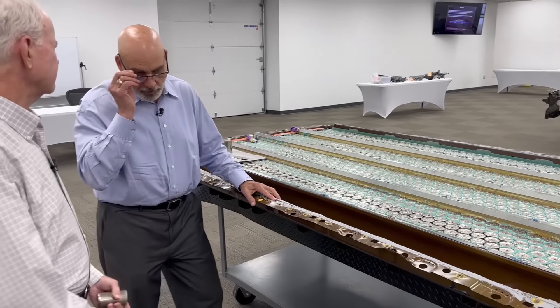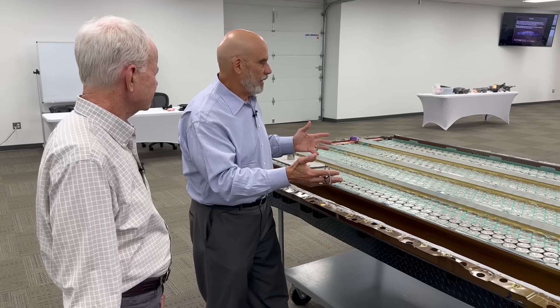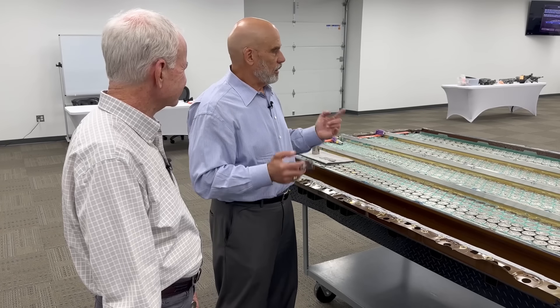Last time we were here, we talked about the water wading mode and the fact that this battery and the penthouse with all the electronics is pressurized because it has a wading mode — a boat mode. It says okay, we're going to go underwater. They have an air suspension anyway, they have a compressor making compressed air, and a large reservoir — it looks like a big scuba tank that's holding that air. When you go to the wading mode, it starts to pressurize the penthouse and the battery. Any micro-leak — if the battery's hot and then you submerge it and the temperature goes down, the pressure is higher on the outside and water always wins. So they pressurize it so that doesn't happen, and you can see why those failure modes indeed do exist.